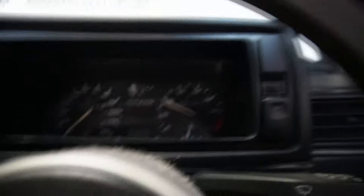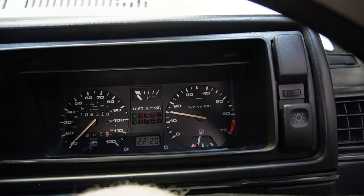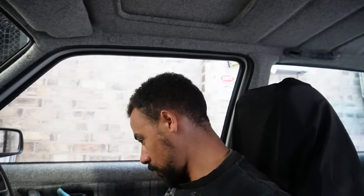The idle is much better now — normally it would be bouncing between 2000 rpm but now we can control where it idles. We've also fixed the throttle cable because the pedal itself was sitting very far back, giving only about 30% throttle. Now we have the full range we can control the throttle much better. When driving around town and on the motorway this car could be quite awkward to drive, but I think that's fixed now. With all the maintenance done, let's tackle those wheels.